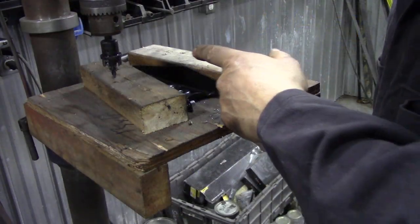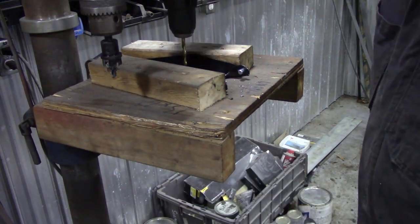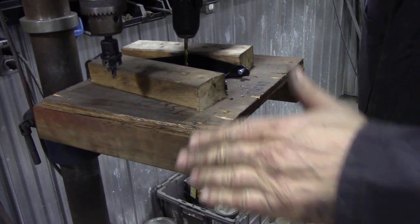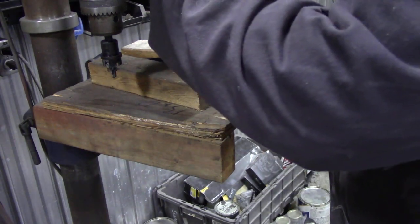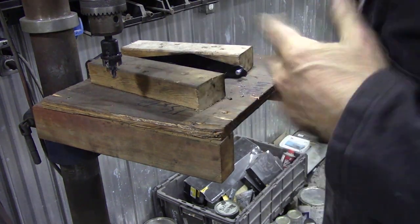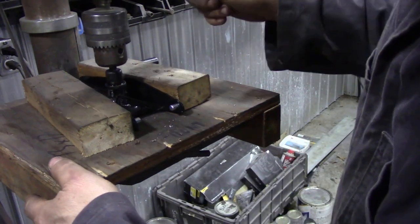Over at the drill press — sometimes the drill bits here are a little bit severe for drilling, so sometimes you can use a regular drill and do a pilot hole first. I like to put a little bit of WD-40 on them just to help along the way. Because it's in a dish, the drill sort of self-centers, so you can't really go very wrong. You can get a feeling for how hard it is. Now we've got our pilot hole.